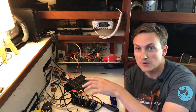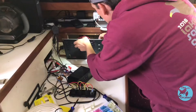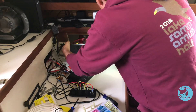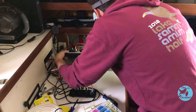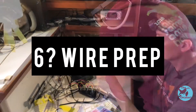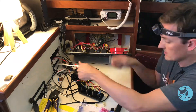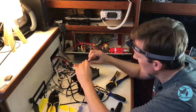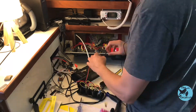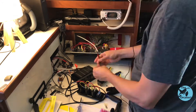We still need light, so all the lights in here are running off battery power right now. Now that the power is off, I'm opening this panel up as far as it will go — all these wires don't really like to move around that much. In this montage, I'm preparing tinned duplex marine wire with heat shrink spade and ring connectors, so that I can connect the new outlets to the boat. This method is flexible and waterproof, so as long as I do it right, my outlets should last a long time.